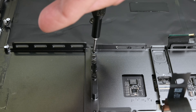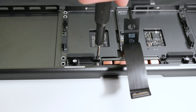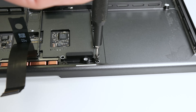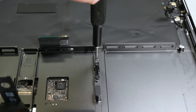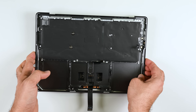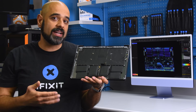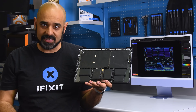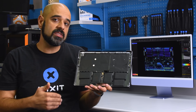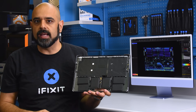The last component to come out in our teardown is the trackpad — a straightforward process, with the only tricky part being the spacers that sit around each screw pillar. And now, finally, after taking apart every single thing inside the MacBook Pro, I'm at the point where the Apple repair manual considers my disassembly process for a battery replacement complete. This is why selling a battery pre-installed in a chassis is such a bad idea — everything I just took apart has to be reinstalled in the new chassis. It's arduous, it's tedious, and nobody really wants to do that.